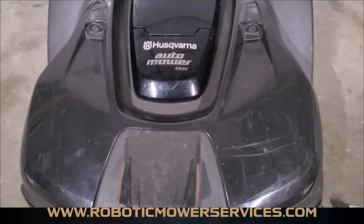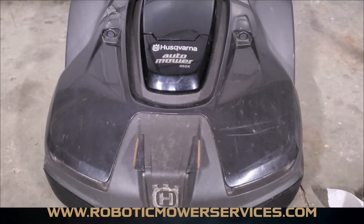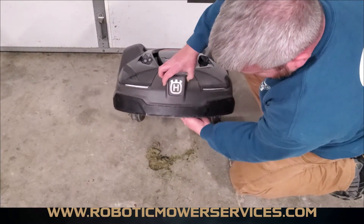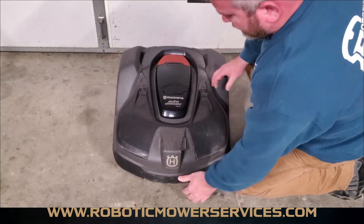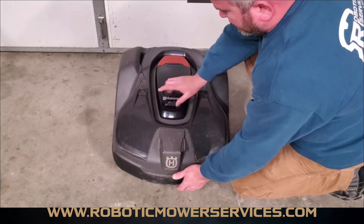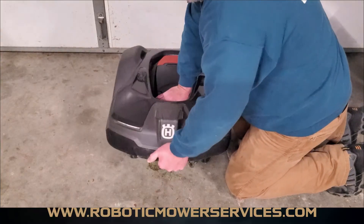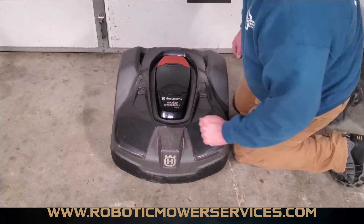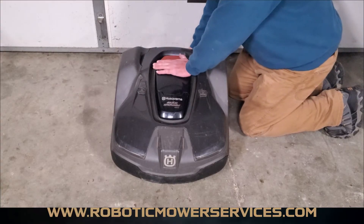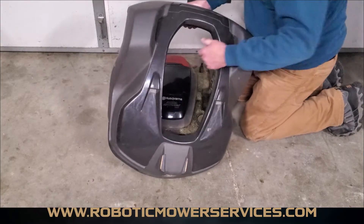The 500 series is the same as the 400 series here. This is a pretty simple procedure. With your wires disconnected and hanging down loose, grab the front bumper of your mower and hold down on the upper chassis on the nose piece where it says 'Automower.' Give a good tug straight up on the front bumper and it will unsnap. Then come to the back, grab the rear bumper — which is part of the top cover — hold down in front of your stop switch, give a good tug straight up, and it will snap right off.